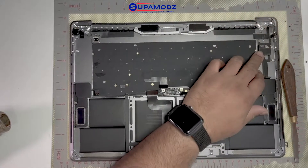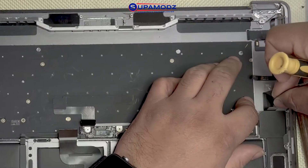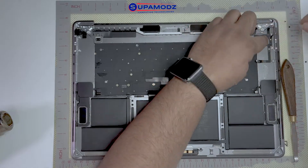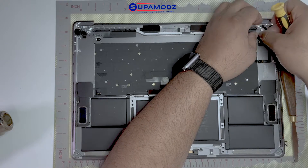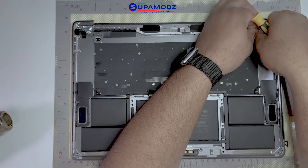What we're going to do now is just remove these two screws here — they're pentalobe screws, the same size you would use for the iPhone to take off the screen assembly. After we unplug this and pull this, the assembly comes down and out. This part here is just a flex cable that connects to the logic board, so you just want to get that out of your way. Now you have two connectors here, they're both connected to the touch bar. We have this one here and then we have this one.